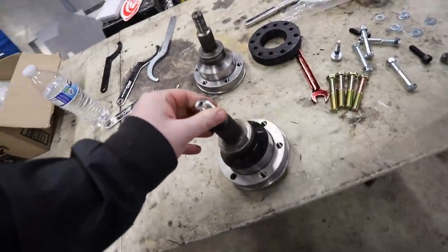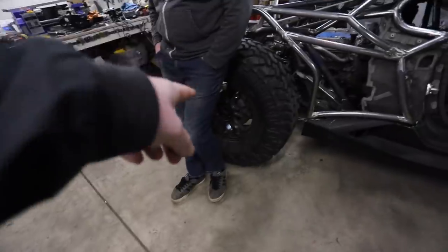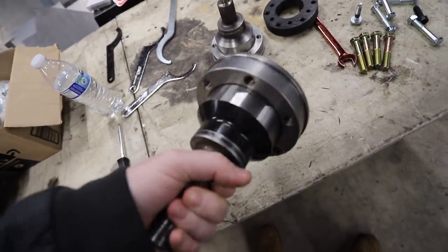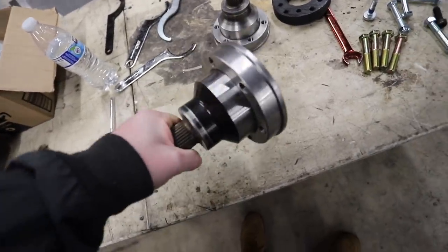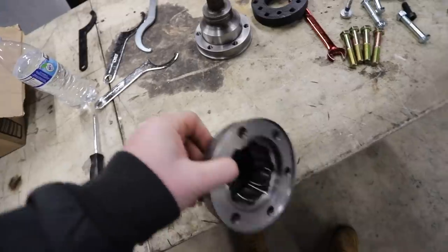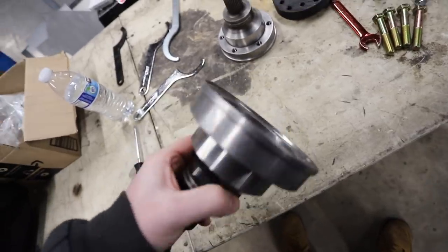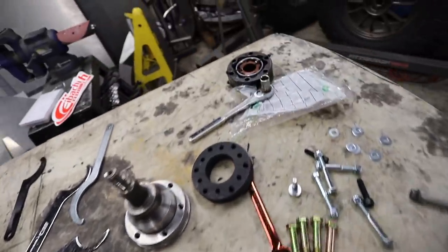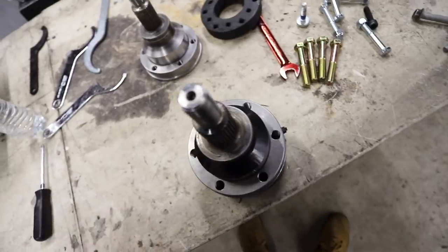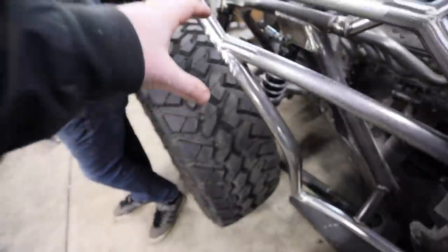Next thing we want to start working on now that we've got the engine and transaxle back in the car is start looking at our axles so we can order our axle shafts. In another episode a little while back, we were looking at a Mustang axle that I bought because we're using Mustang GT hubs inside there, wheel bearings. So we got a Mustang axle, ripped it, and this is the stub off of the Mustang axle. Then we had our machinist go ahead and build us this guy — it's like a slip fit. This slips into that, and this is going to be welded up by us. He put some threads in there to match up with our CV. These are long travel CVs that are going to allow us to have a ton of angle. So that's how we have the axle going into the wheel hub, wheel bearing, and powering this whole wheel.